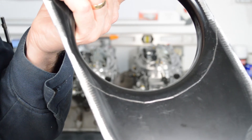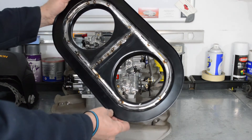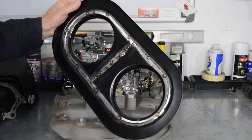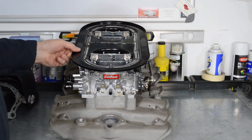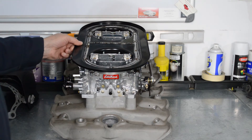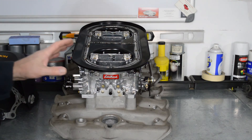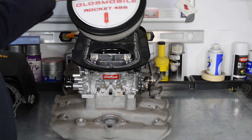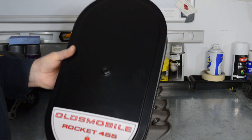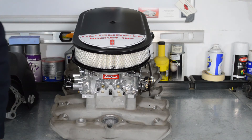Two more curved freehand cuts with my cutoff wheel and I'm ready to weld this thing together. Got it cut out, got it all tacked together - I think it turned out rather well. I've got a bunch of welding to do but it's the basic shape, it's nice and firm, and most importantly it fits. It's got a little bit of wiggle room so it's not binding anywhere. I'm kind of a sucker for a good decal, especially something that looks factory - I had this custom made and this way it'll at least look somewhat stock as it goes on the car.